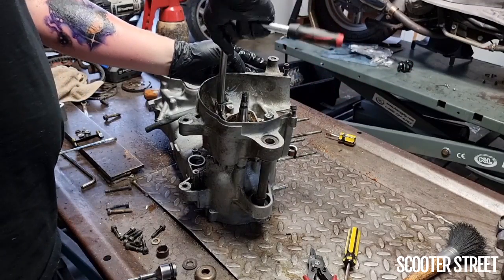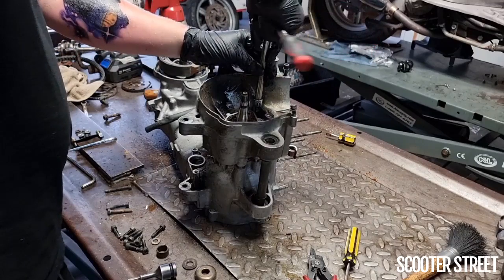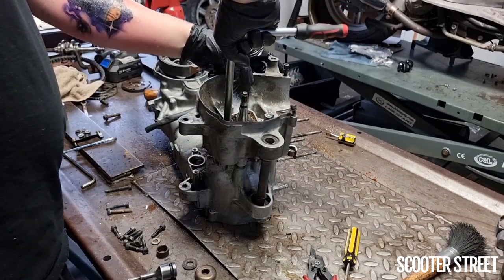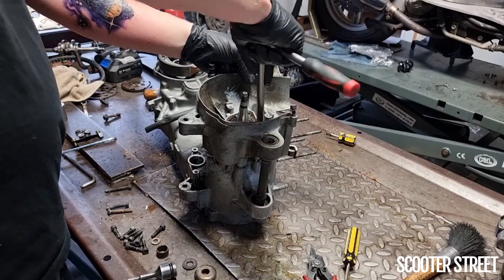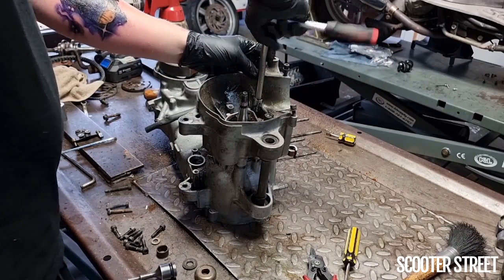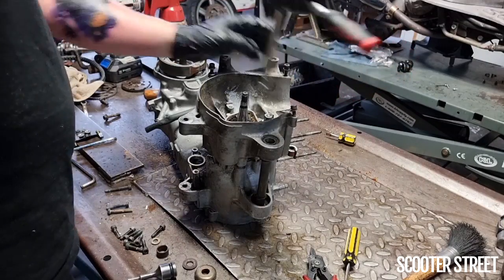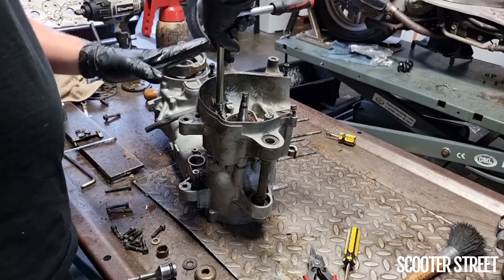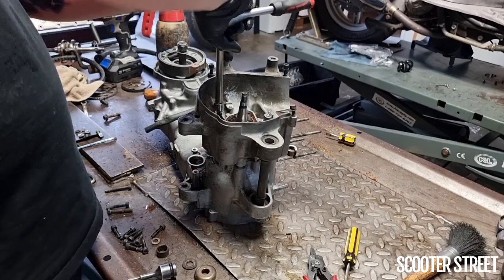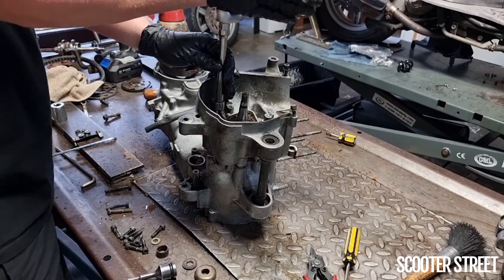So when we're doing this, we're talking quarter turn at most. So that one's a little bit loose, but once you have tension, at absolute most, quarter turns. There it is, that clanking noise. So notice when you come to each bolt, every now and again, after it's had that little clank, where it's sat down a bit further, the bolts will all be a little bit loose. So when I say a quarter turn, I mean like, say, from 12 o'clock to 3 o'clock.